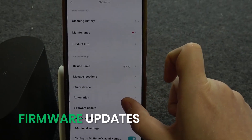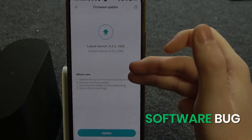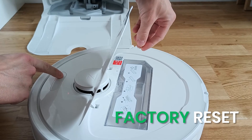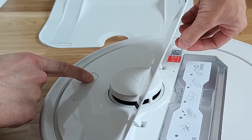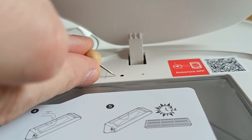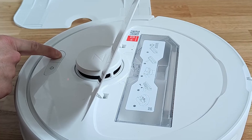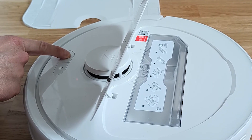Don't forget to check for firmware updates using the Roborock app — a bug in the software could be misreading a hardware issue. Still not working? Try a factory reset. Press and hold the home button for 3 to 5 seconds. While holding it, use a pin to press the small reset hole near the Wi-Fi light. Keep holding the home button for 5 more seconds until you hear it say, restoring the initial version.